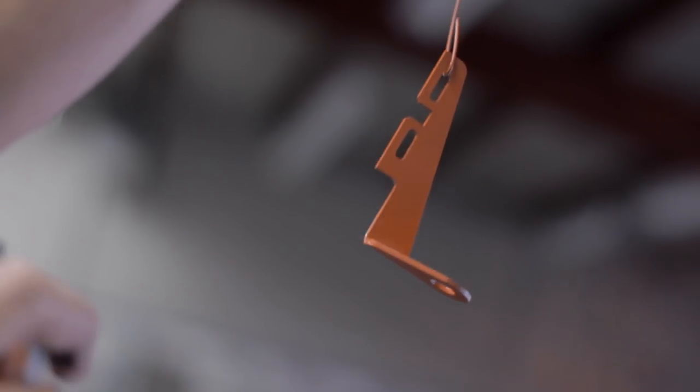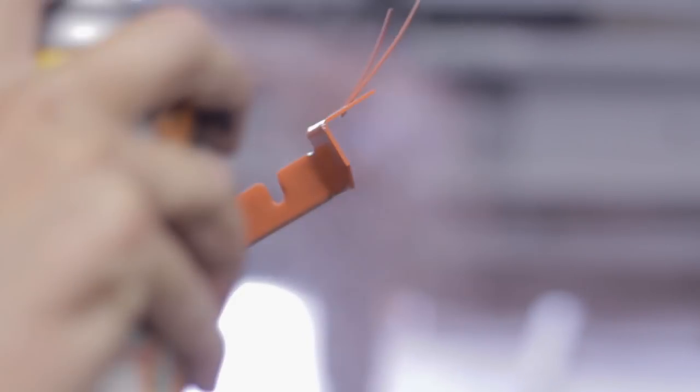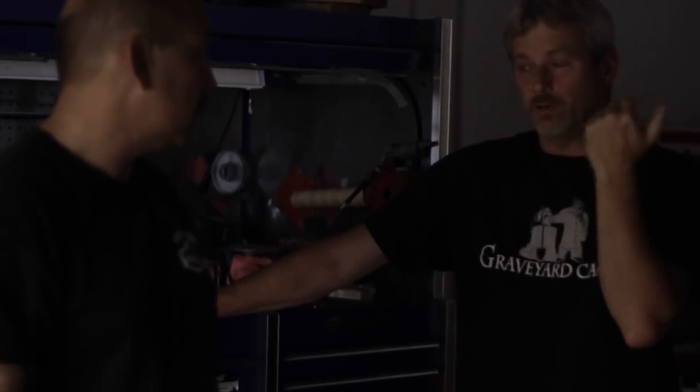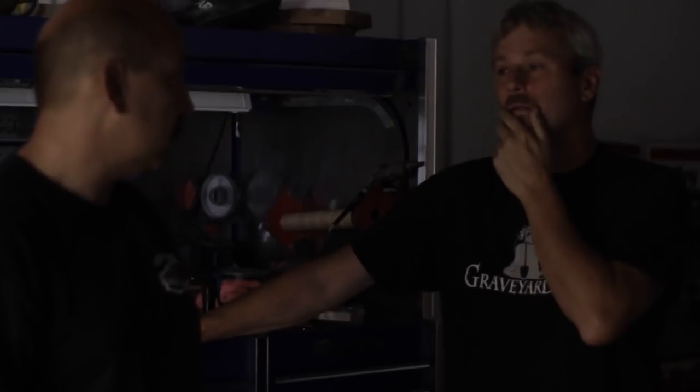I don't know what we're gonna do with some of those wire brackets on the head bolts. The spark plug wire separator brackets hold the actual plastic separator that keeps the spark plug wires from hitting things like the exhaust manifolds and getting caught up in the fan. So it holds them in place and routes them to the necessary areas of the engine compartment. Take it off, put it back on. I don't know if we can get to it, with the exhaust manifold in the way.